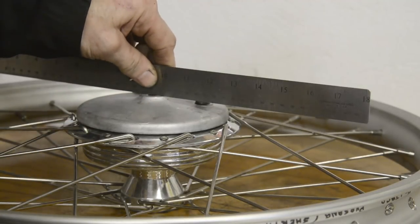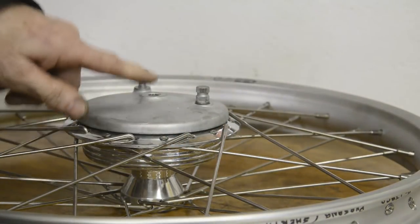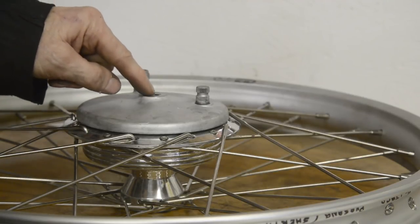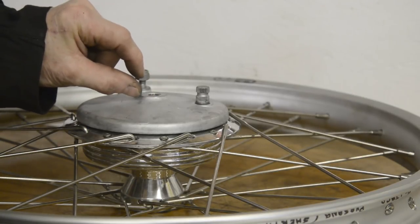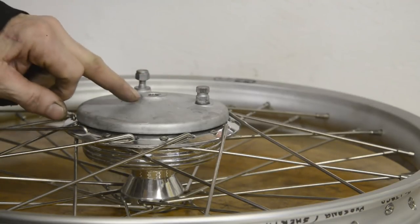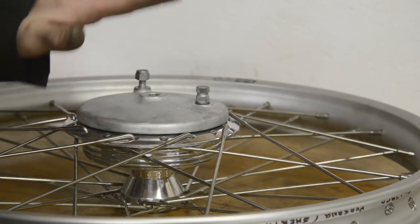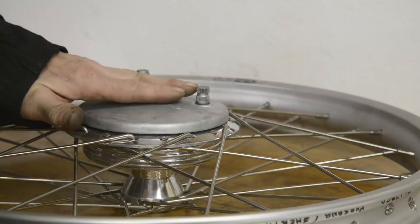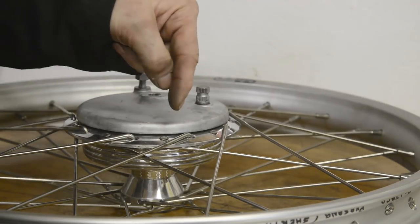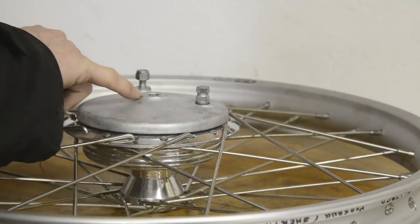But in the centre, that is 4 9/16, and the datum plus our 5/8 is only 4 7/16, so we're thicker by an eighth. But we have this boss here, and I can take an eighth off this without it getting too far down. So I think we're all right. We'll take an eighth off, and that'll put this up against the fork, and we'll be clear on the other side, and we'll be centered. So it will fit, but I've got to machine this.